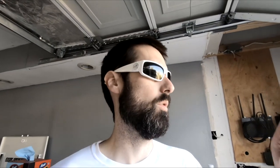Wasn't that hard. Pain in the ass just to pull the seats back out, but I wish I would have caught it before. So if any of you guys are going to install that lift, the lift for the rear seats, make sure you either cut that cable and extend it, or replace it with a longer one, or remove it altogether. After I already did one and I was on the second one, I started thinking, I don't think those are going to do anything anyways, because the little metal brackets that the seats sit on now, those are powder coated.